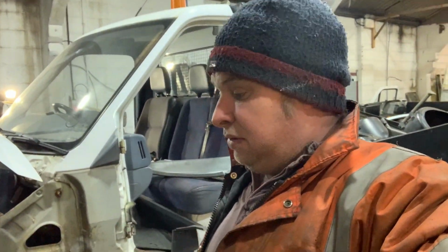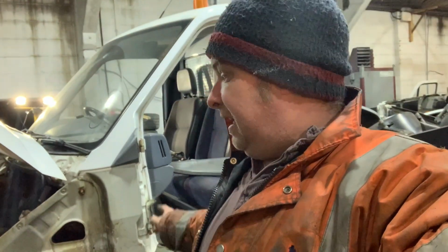Today I am back on Sprinter footwells. I'll try and stitch the driver's footstep in today and make the back sill fit, and then I will go and remove the outer sill on the passenger's side and make the passenger's sill fit, not the driver's. Then I go over to the other side and remove the rest of the driver's outer, and show you how I am, or you should, fit the new panels in. Right, I'm going to get going. More of the great, marvellous time lapse, and I should be back in about half an hour, I reckon.